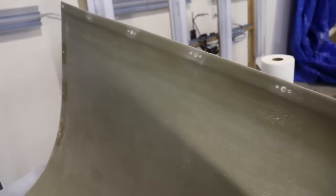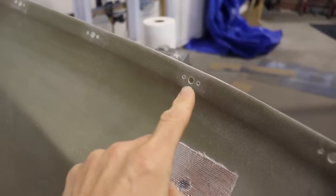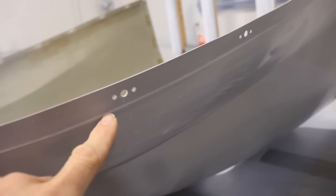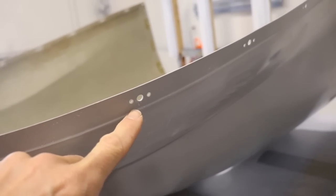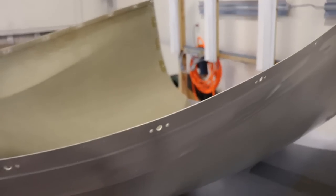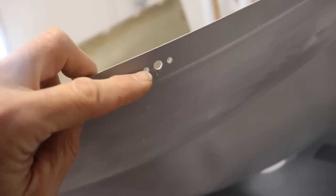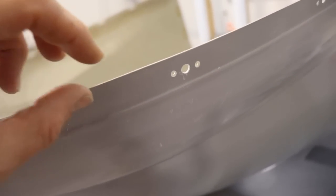In preparation for the new nut plates I'm putting on, I've taken 80-grit sandpaper and scuffed up all the places where I'm going to put a small square of fiberglass. On the outside I'll mix up that peanut butter resin solution I showed you in the last update video and fill these two holes on every one of these nut plates — I think there's 14 total. Once that resin is dry I can sand them smooth, leaving just the big hole, and then put in the new nut plates and drill the new holes.